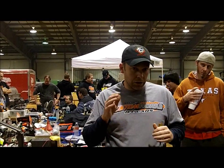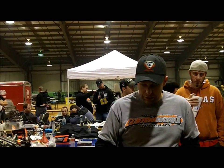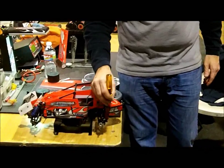When you pull them back, the gain is when you get on throttle, it'll turn more on throttle. However, your entry will also be a little more subdued. This car's a little longer, the weight's not slung over the rear. That, like we were saying for grip, we're all the way forward.